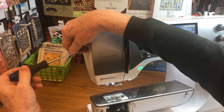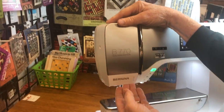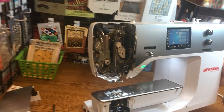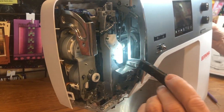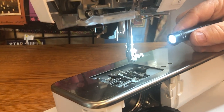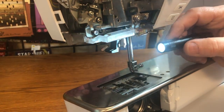Now let's go up. This little head plate comes off — you take a 20 Torx tool, which comes with your machine; it's L-shaped like an Allen wrench. Take out the screw at the head, lift up right where it says Bernina, and this will come off — it's a bit tight when fresh. I'd recommend turning the machine off here because you don't want to touch any electronics while it's on. Use your light — dust and thread accumulate right in there where I'm showing. Use your tweezers and brush down in here. This is the end of your needle bar; brush off all that lint. You might want to do this before cleaning the lower area since lint tends to fall downward.